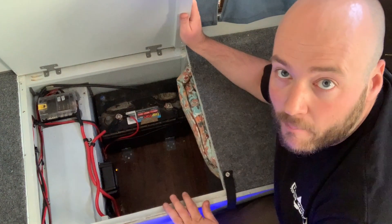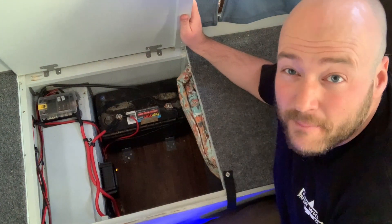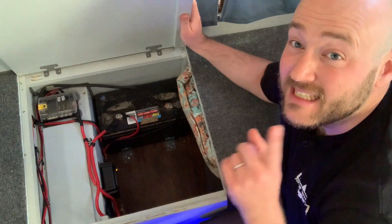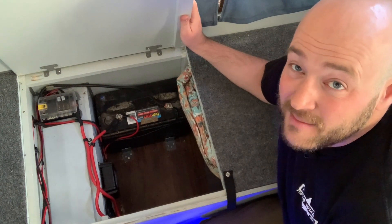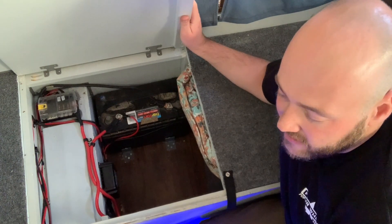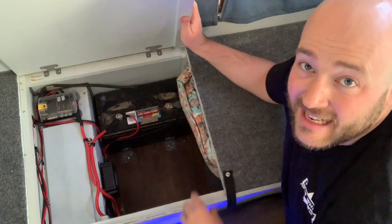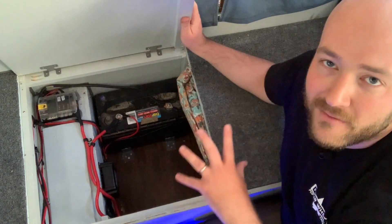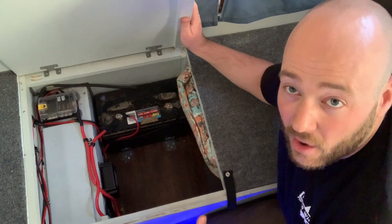What I've got is obviously a big old battery. This battery is huge — it's 122 amp hours. To me, that is like a boatload of capacitance. The thing is, I barely have any electronics in here. I've got some LED lights and I've got a cell phone charger — that's it. Maybe I'll be upgrading to a diesel heater sometime soon, and that will need a fan. But I don't have any electronics that really pull a lot of power. I don't have a fridge. I don't have a furnace fan. I've got nothing. Because of that, my battery is pretty much like an infinite pool of electricity — all those little electrons just hanging out ready to power my lights. I could leave my lights on for like weeks and it would be just fine. So it's huge, and I don't even need that much solar on the roof.